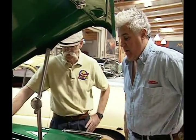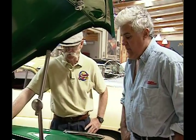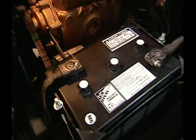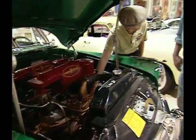Well, you don't have that problem anymore with a 6-volt alternator. It keeps it right up. It's the top of the voltage. You sort of lose that mood lighting thing. Yeah, you lose the mood lighting, but your radio works, and your turn signal works, and your brake lights and stop lights. It's a lot more compact. The alternator would be about almost twice, the generator would be about twice as long, is that right?